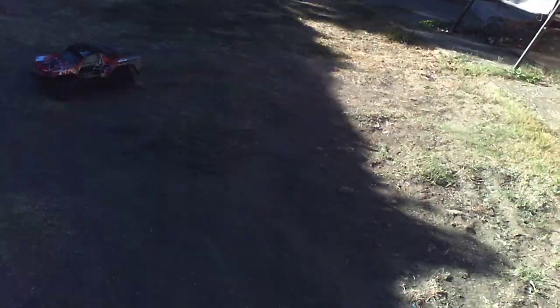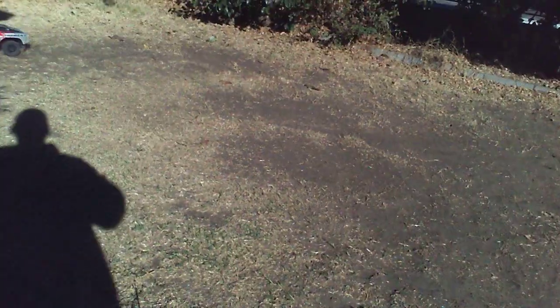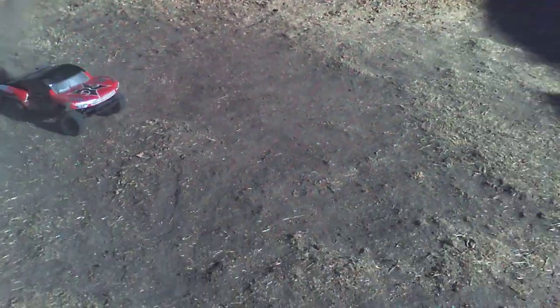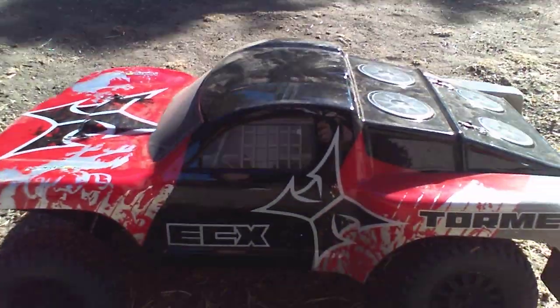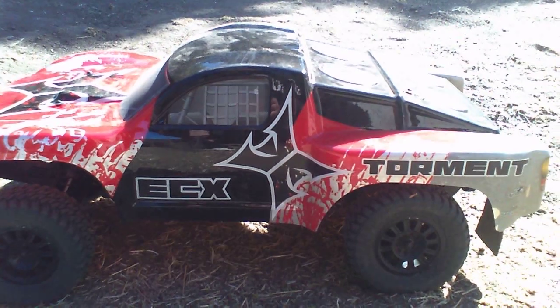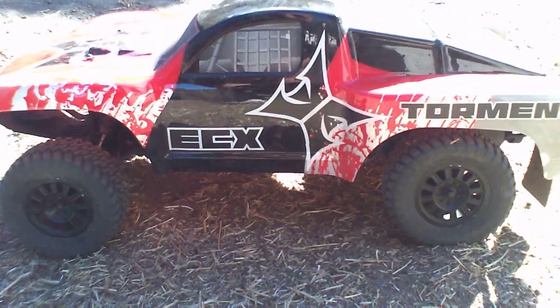We might be able to run for a few more minutes. The little Amp's gonna run real good with that setup because this car ran really decent with it and it's a lot heavier and bigger. In the Amp I'll be able to run 2S and it's gonna be really quick and handle well — not overpowered and flipping every time. When I say that I rolled it — short course trucks roll — but with the Amp I couldn't really gas it much with that 4370KV. It just wasn't fun brushless unless you go with something smaller like a 3,000 or 3,300KV on 2S, which would probably be fine. But with the 4,370 it was too much; in this car it's perfect. All right guys, peace.